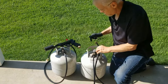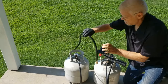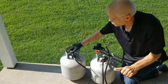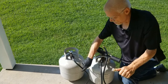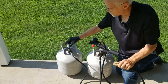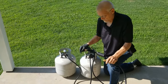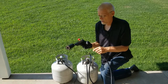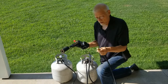If you make the mistake of leaving this on and allowing it to sit overnight and condense — which is what this one has done — I turned the valve on, had the hose connected, it was hot yesterday with gas propane in the hose, and it condensed overnight. This is why the instructions say to always use the Grill Gun to completely eliminate all propane — burn it off before you turn off the valve and quit using it for the night. I'm going to demonstrate why that's so important.